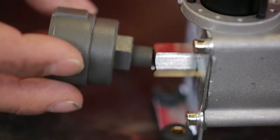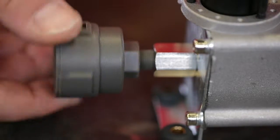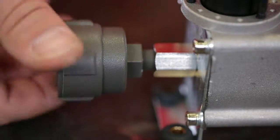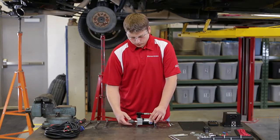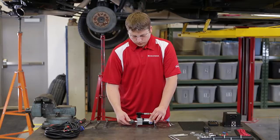Next, attach the air filter to the compressor and hand tighten. If the compressor will be located in an exposed wet location, rather than connect the filter directly to the compressor, you should snorkel the air inlet filter.